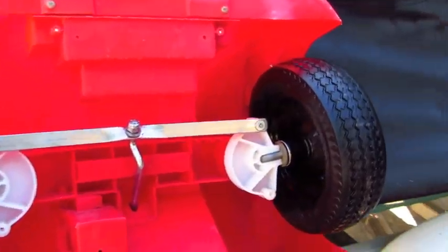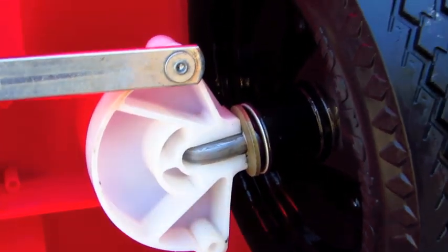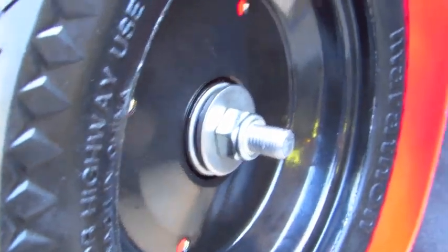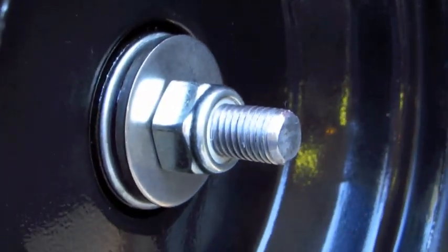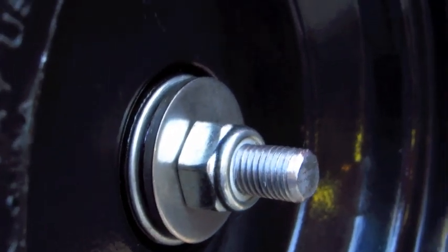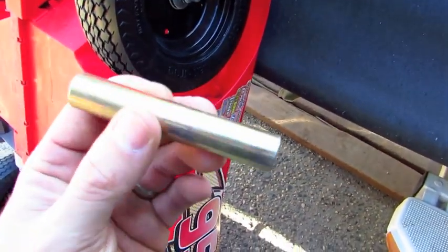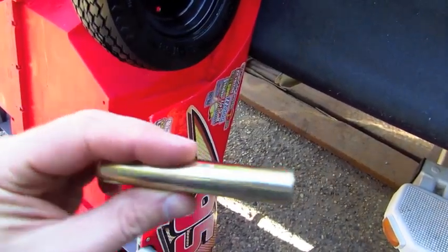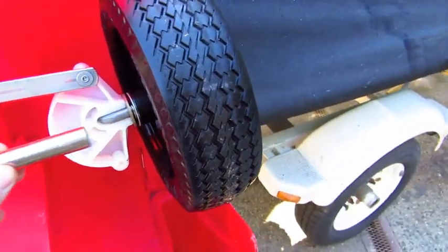For the front wheel setup, as you can see, there is a long shaft offset that goes to the inside, and then the outside is a flush mount. So the existing spindle — I ended up threading the outer spindle and putting a nylon stainless lock nut on the end of it with a washer. And what you're seeing on the spindle itself is one of these sleeves — I picked it up out of a suspension kit that we did for a Chevy pickup a while back — cut down to the width of the spindle itself and sleeved on there.